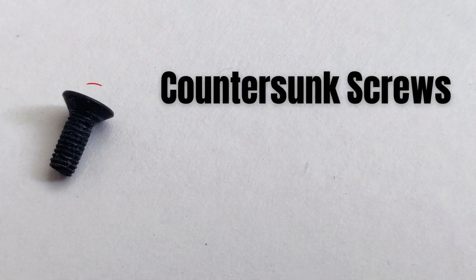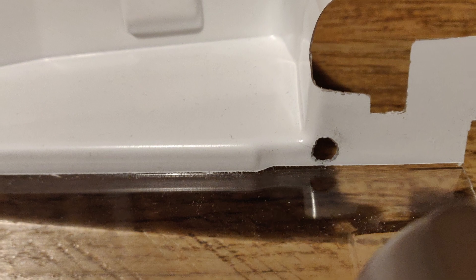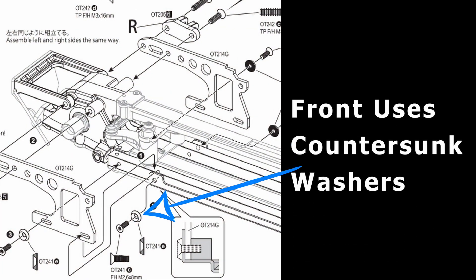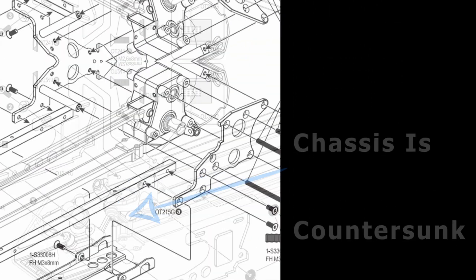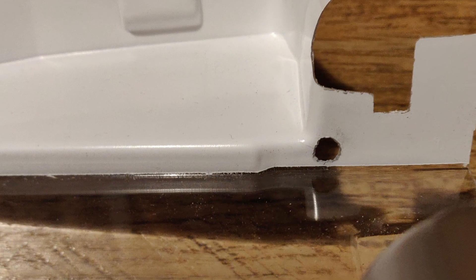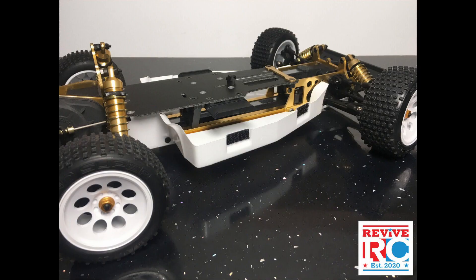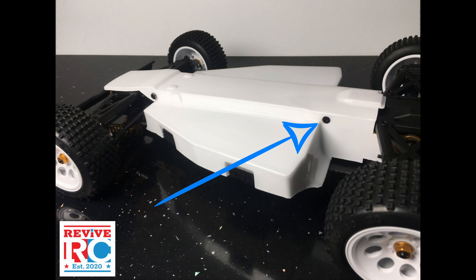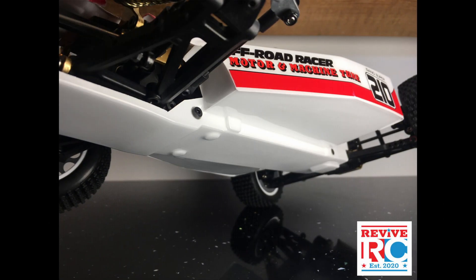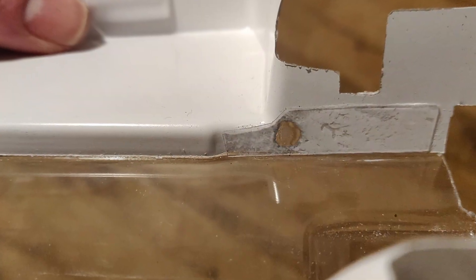When it came to screwing this into place I did have a couple of setbacks. The head of the countersunk screws can have a sharp edge around the top and mine cut straight through the Lexan. Unlike the front mounting position, the rear doesn't have a countersunk washer — instead the chassis is countersunk to house the screw. This is why the screw just cut straight through the Lexan. I really should have foreseen this, but the images on eBay and the one video I saw just screwed it into place without any additional hardware, so I did not stop to think.